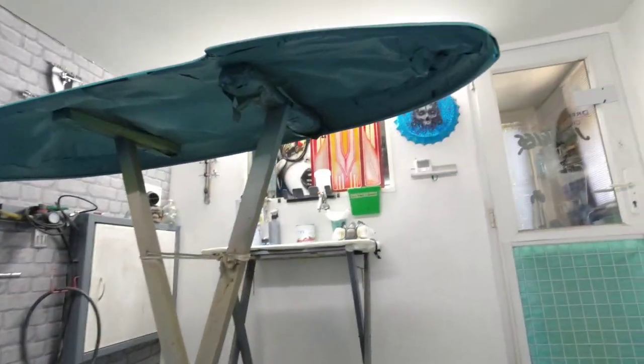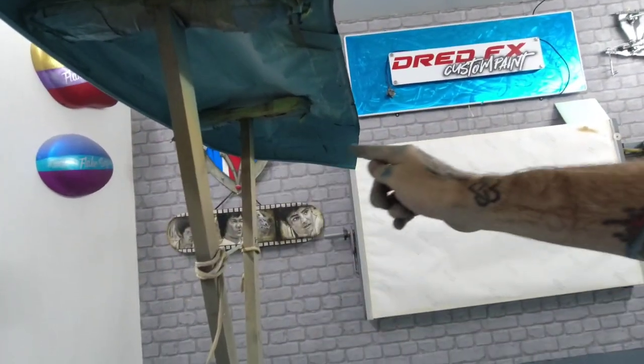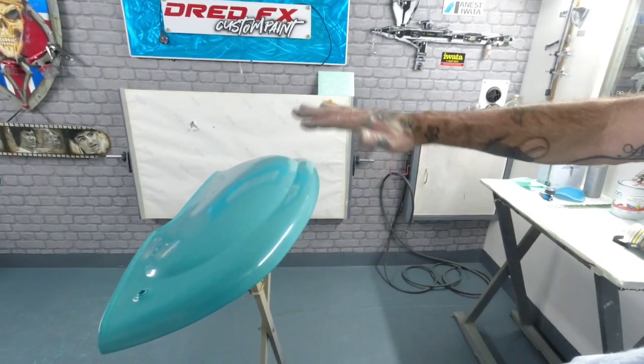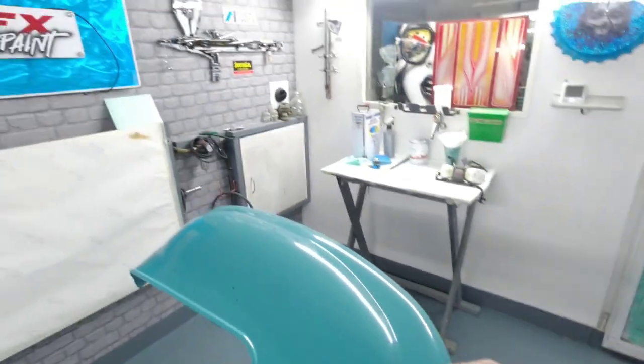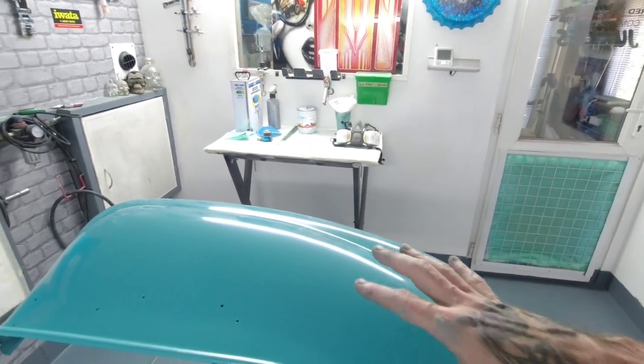We've got all the edges all the way around on both panels, so they're all covered up nice. Three coats on these, so we're going to let these cure right down, let them go off. Probably 2 hours I'll leave this, just let that base coat cure right down, and then we're going to go in and just flat these over again, and then we can start dropping in the 59 on here, do the airbrush work on there, sort all that out, and then move on to the clear coat stages and we'll be done. So I'll see you in a bit when these have dried off. I'm going to grab a coffee. I'll see you in the next step.